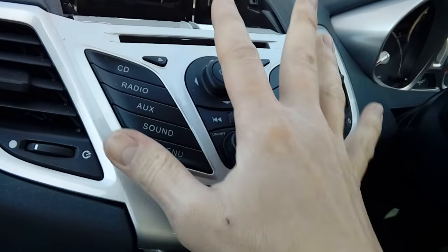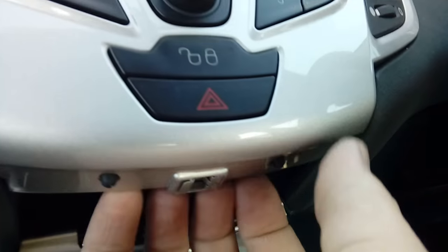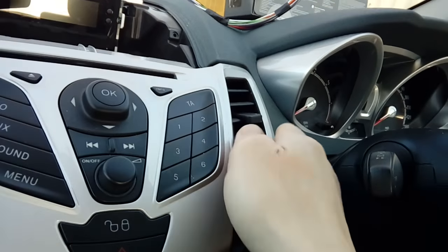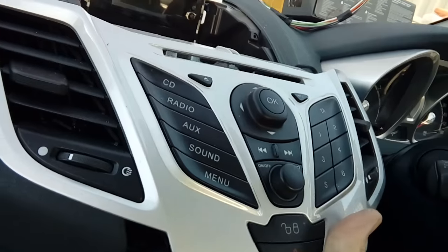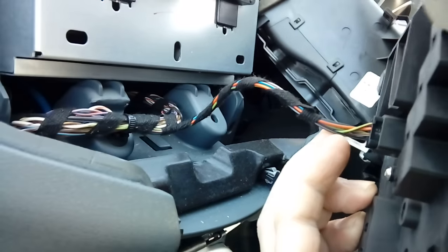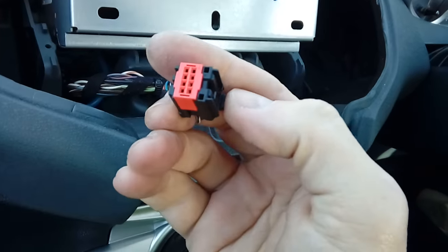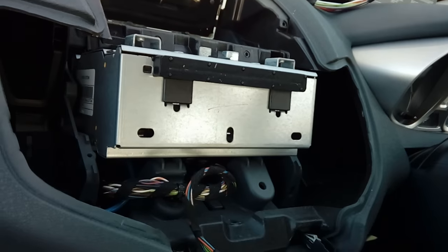If it won't move at the top, put your hand under the very edge here and sort of pull — there we go, you'll hear a click at each corner. Gently ease this section forwards to reveal a wiring connector just there — it's a squeeze and pull to remove that. With the fascia removed and out of the way, there's the connector — it's got a little squeezy tab on it, so squeeze the tab and pull. That takes your whole fascia out of the way.